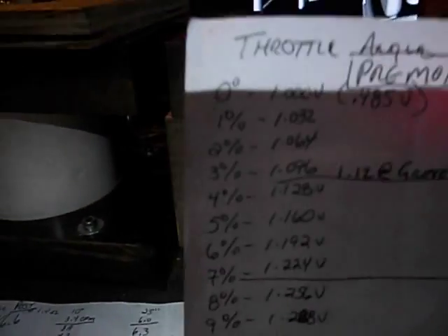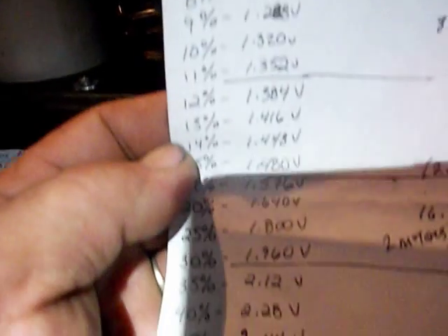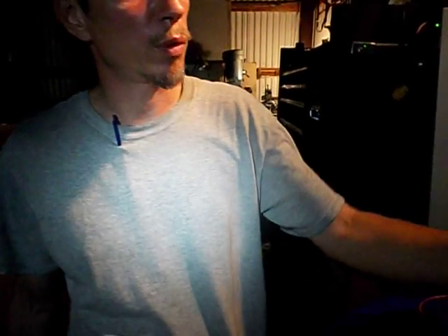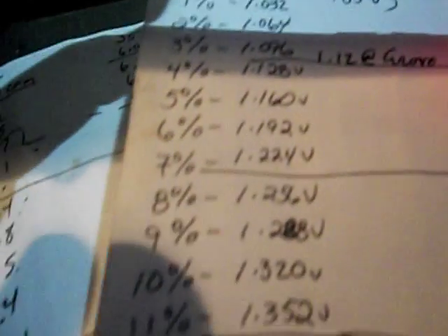This is the testing results. What we did was we set it up on various percentage levels. What Mike did was find out what the idle TPS voltage would be with the 5-volt power supply, and then what the wide open throttle voltage would be, and broke it down into a percentage of throttle angle. So we're looking at high resolution at the near-closed throttle angle — 1, 2, 3, 4, 5 up through 15%. Then from 15 we jump to 18, 20, and then it's 5% increments the whole way up to wide open throttle. That gives us a before and after comparison.